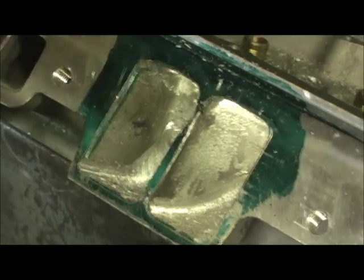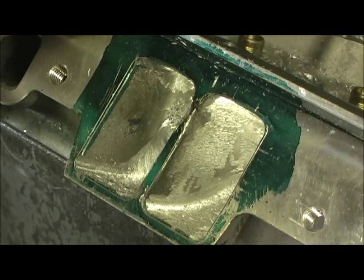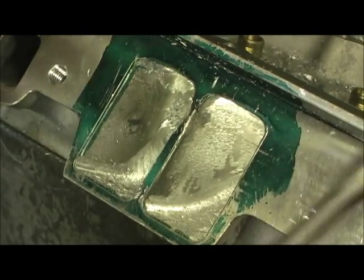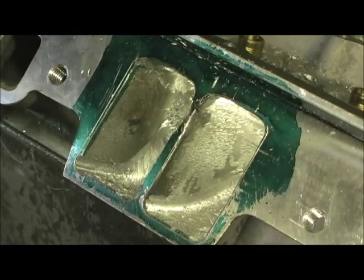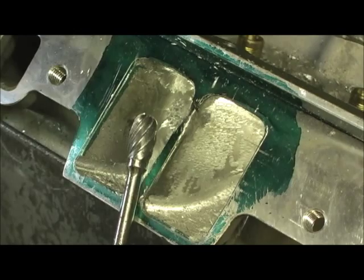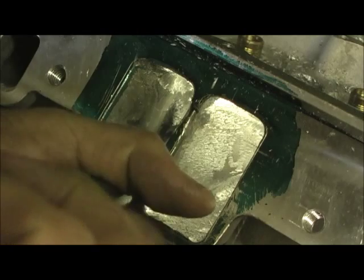Now we're going to go to the trench digging on the pushrod side. Remember, this is going on a 438-inch small block, so we're hunting for volume as much as we can get with the 1206 entrance. I am going to be moving this over a little, but mainly what we're looking for is that's the smallest aluminum egg that I got right here. What I want to do is come in right at the short turn radius.